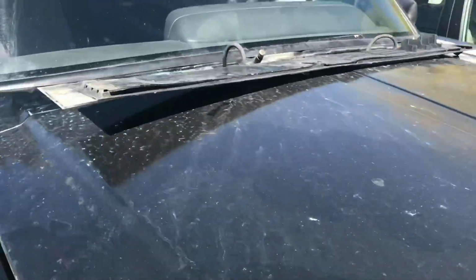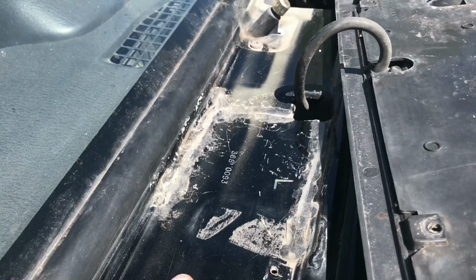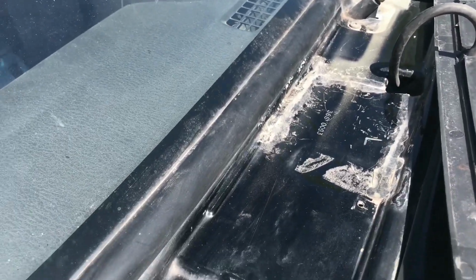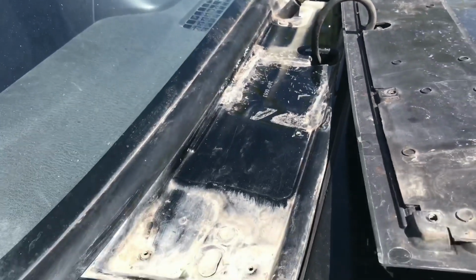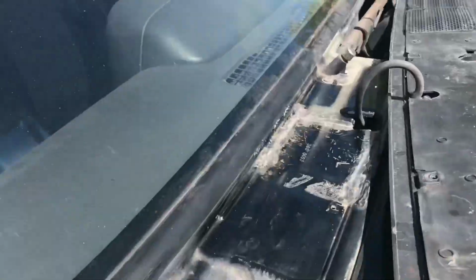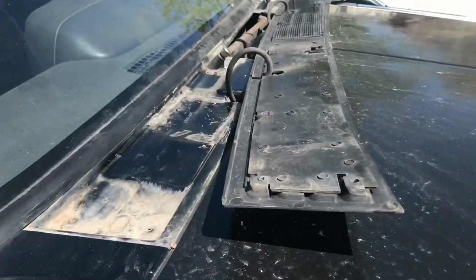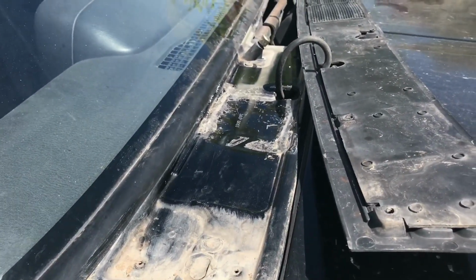But if you follow this quick guide, I'm not showing you too much, but it's common sense enough in my opinion. You just cut that back, silicone the outer ring of that guy. It should keep enough water out to seal the leak. For all XJs, it might not be that this is your leak point. I know that you can have a ton of leak points in here, whether it be from your window seals to your B-pillar seals to firewall seals, whatever it may be. But that is what worked for me, and I hope it works for you guys as well. Thanks for watching.